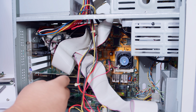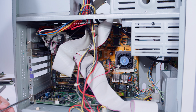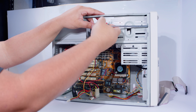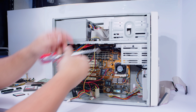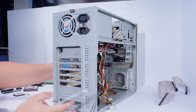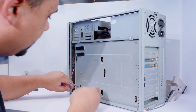I actually didn't have any problems with getting any of this hardware to work. I didn't even have to install anything except the Voodoo drivers, and everything else just worked. It was brilliant. The power button on this is an AT power button, which isn't a momentary switch, it's a hard switch, and we need to figure out a way of making soft power for this. The backup plan is to use the reset button on the case, which can work no problem. We can do that if we really need to.